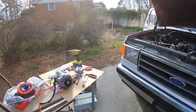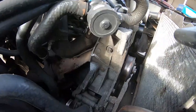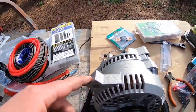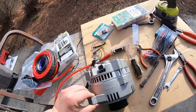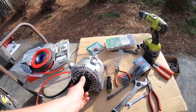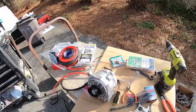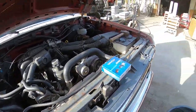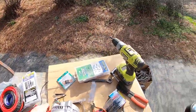We're gonna have to come back to this in a little bit - I got the wrong alternator. I had this thing mounted up in there and I was shaving off a little bit of the bracket where it was hitting, and found out that my bolt holes don't line up. This isn't long enough - the distance from the two mounting plates is not enough. I think the Taurus 3.8 liter alternator is the one to get. I've already ordered one on Amazon. The local auto parts stores couldn't get it to me any quicker than Amazon and Amazon had the best price. It's inconvenient - my truck is kind of incapacitated right now but we'll work around it this work week. I'll update you guys when that happens.